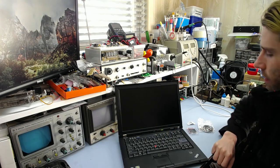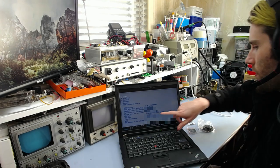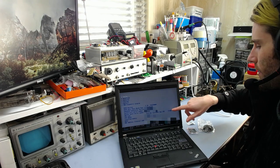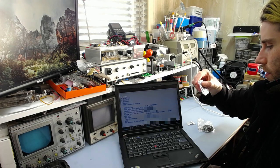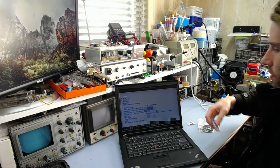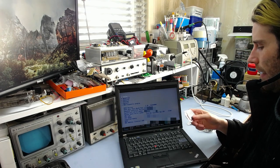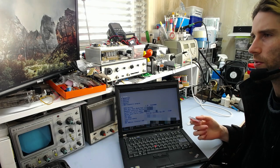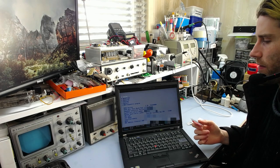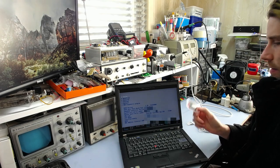I think there's a T7100 in this thing. Looking at the BIOS, we've got a Core 2 Duo T7100, which is 1.8GHz. The one I bought is a T7800, which is 2.6GHz and has a higher cache — I think twice as much — so it should be a fairly decent upgrade. That's the highest official supported CPU. I didn't really want to go for an unofficial one and have to change the BIOS, because supposedly the thermal sensor doesn't work with that and the BIOS basically just disables thermal sensing. So I figured I'd just get the highest official supported one, which is the T7800.